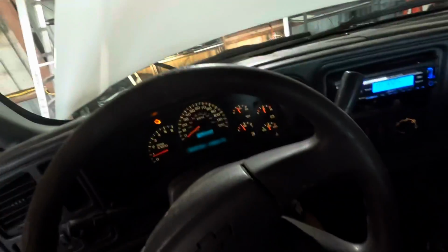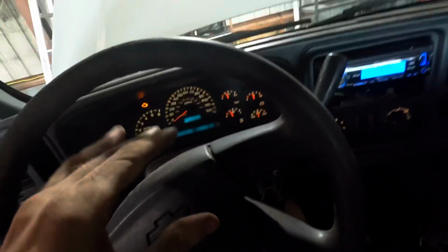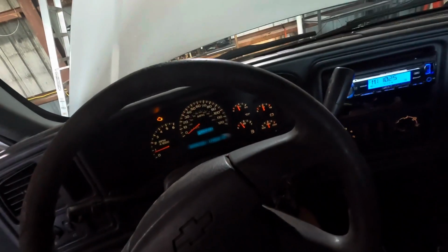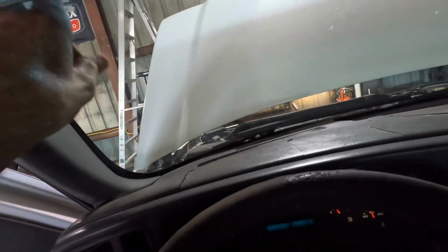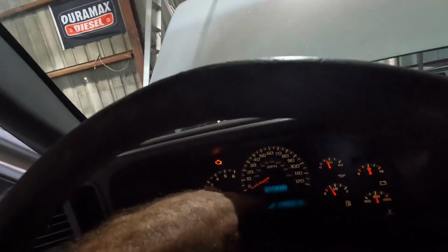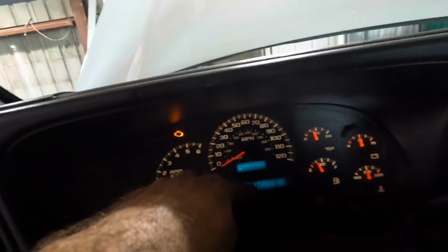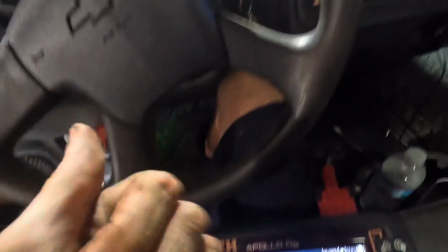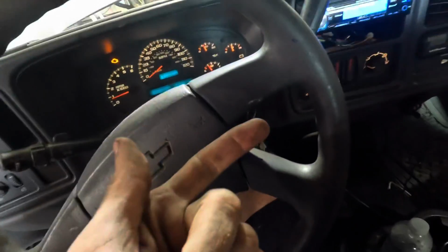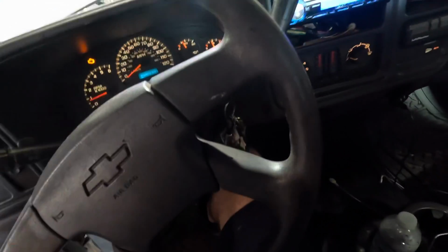At this point, what I need to do is go ahead and report some good news that the thing does run and does function, and I'm going to submit over an estimate to get this thing caught back up on maintenance. According to the oil change sticker, it is 14,560 miles past its oil change interval. Needs some wiper blades on it. It does need some spark plugs. Those wires are 20-something years old. I do need to put some wires in this.